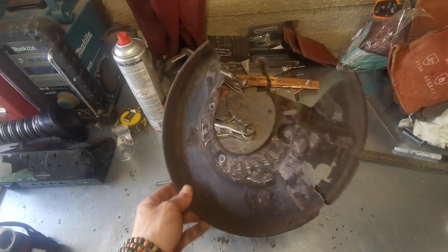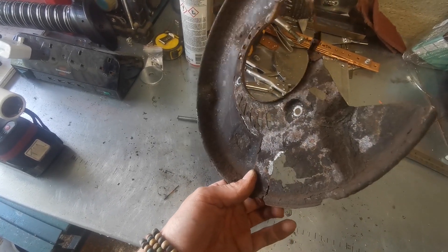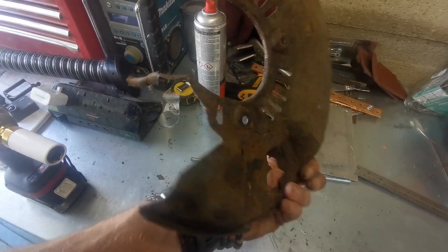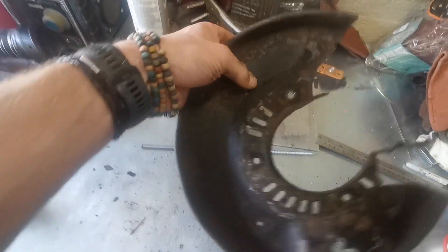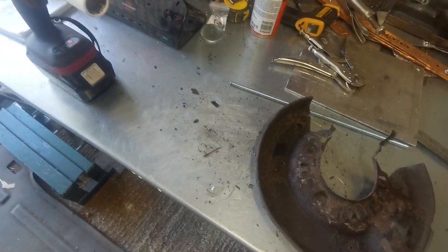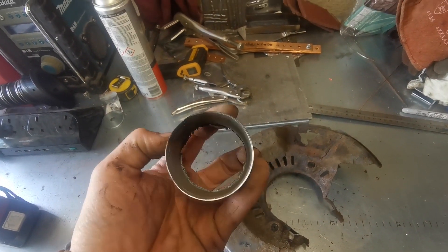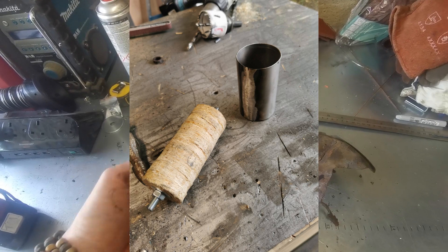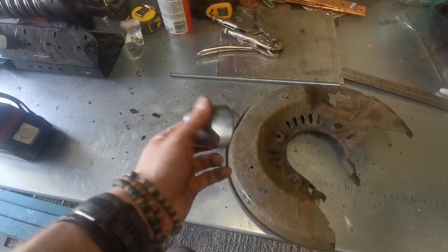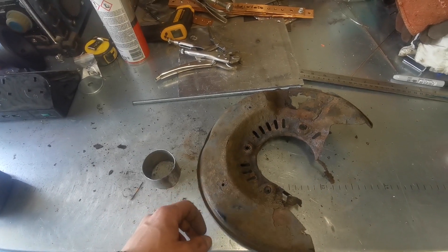This is absolutely rank. I should probably buy new ones, really. At the bottoms there, just absolutely wrecked. I think this is actually prime for a bit of practice on sheet repair. I'm not too arsed about the bottoms — it's up here where it's still got paint on, so the metal is reasonable. All I'm going to do is weld on, on the other side, a bit of two-inch tube. I actually made this two-inch tube out of a piece of sheet and rolled it around some wood that I cut — it turned out pretty sweet! Going to weld on there. After you've cut it in, punch a little hole through, get it welded on, stick it back on the car, see how it looks, and have a look at routing our silicone tube. Let's get this done.